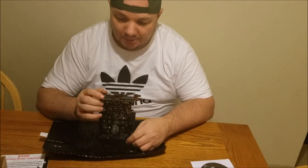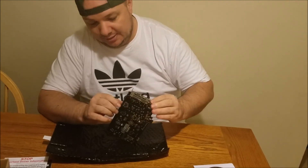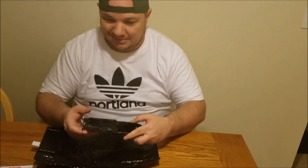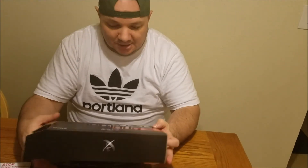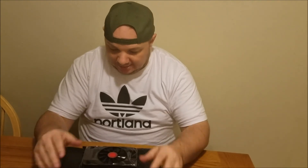It has HDMI 2.0, DisplayPort, and DVI — no VGA, which in this day and age not a lot of cards include anyway. Some highlights of this card: DirectX 12, FinFET 14, HDR ready, FreeSync, fourth-generation LiquidVR technology, AMD Virtual Super Resolution, Radeon Software, Vulkan ready, CrossFire, DisplayPort 1.4, PCIe 3.0 support, OpenGL 4.5, OpenCL support, and of course HDMI 2.0b.